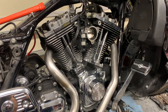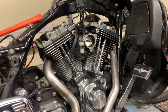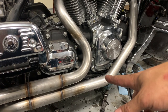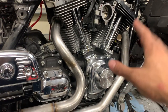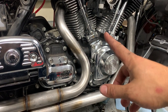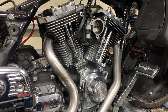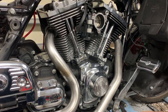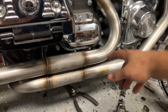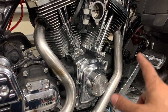All right, so I've got the exhaust basically installed at this point. I still have to tighten a few things down. So far, this has been by far the most aggravating part of the project. So I'll explain why. S&S makes this Y-pipe as a single piece, and theoretically there is enough give to get it onto both cylinders. But the way they tell you to do it is to get the rear cylinder seated and then, with a quote unquote firm tug on the front pipe, get that seated. There was a lot of cursing involved in getting that done. Did finally get it. My tip would be, now that I got it on, if you can have a second person, that would be helpful, because to get the orientation right, having somebody pulling up in this area will help to get the front pipe where it belongs.